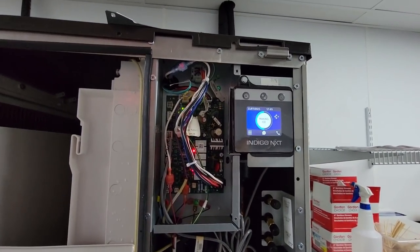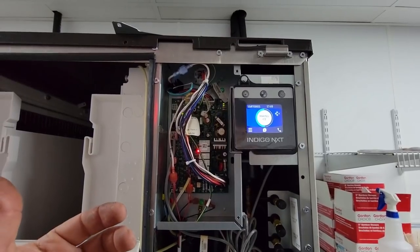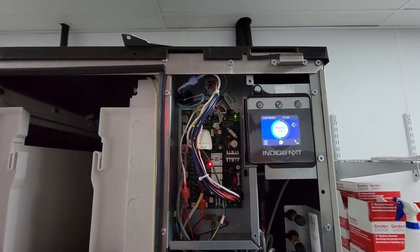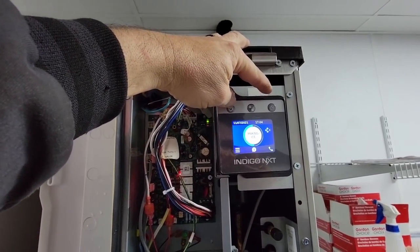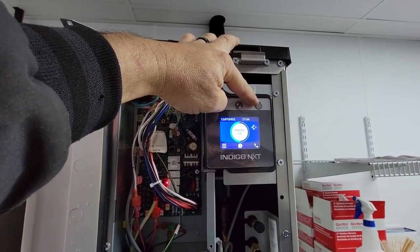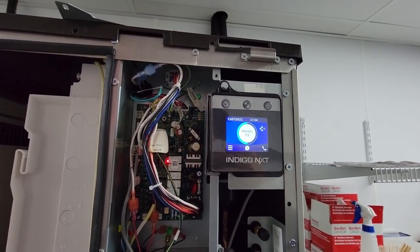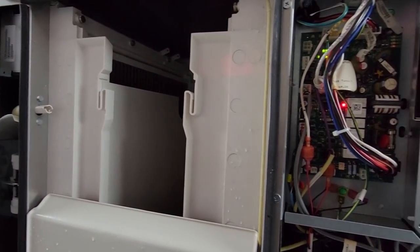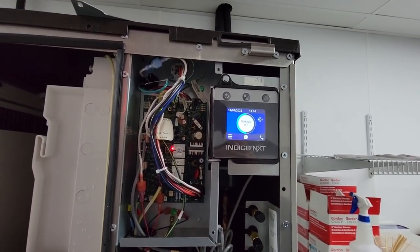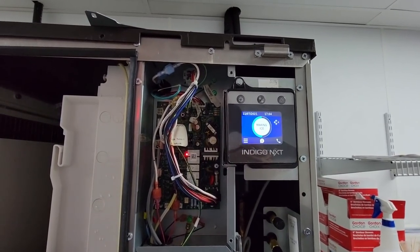I tried a few things to get this stupid thing out of clean mode. I asked during a podcast and they said update the firmware, which I haven't done. I tried pulling the power, holding the button while restarting, letting it out for so long — none of those work. It holds it in memory. What I figured out was if you hit the power button while holding that and hit clean, it asks if you want to go into clean mode — it'll be locked for 30 minutes — and then it gives you the option to abort. I aborted it. Boom, went back into making ice.